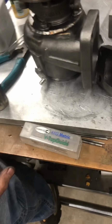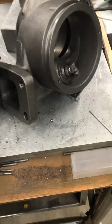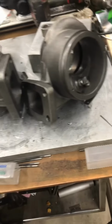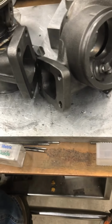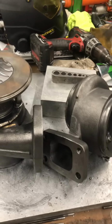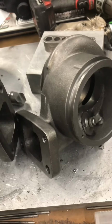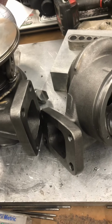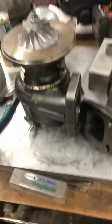If you're running a common rail injection system, your common rail ECM is calculating all this stuff in real time. I've had some friends of mine with common rails who do truck pulling send me data logs, and you can see the ECM calculating all this stuff in real time based on the MAF sensor, the boost pressure, and air temp. Some stuff has air temp before the turbocharger, but most just have air temp at the plenum, and then it knows engine RPM, and it knows the engine's theoretical efficiency based on a factory mapping that's already been installed on the ECM, and then it uses these to figure out how much fuel to inject. That's what you're toying with in EFI Live: you're messing with the air to fuel based on all these different factors to make all this cool horsepower.